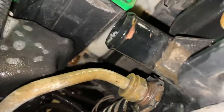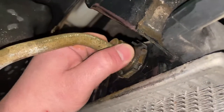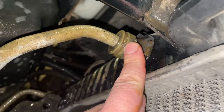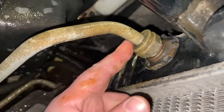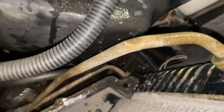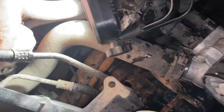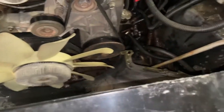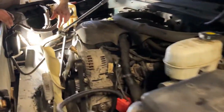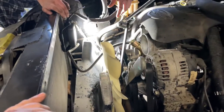Same story on this side on the oil cooler lines — we've got this clip. I can't get this one with my hands; I'm going to need a screwdriver. There's a clip inside there. Get an oil bucket to catch any oil. We already caught the coolant — drain your radiator first, that's always a good idea. There might be a radiator drain down below depending on the year, the model, or if it's been replaced before.